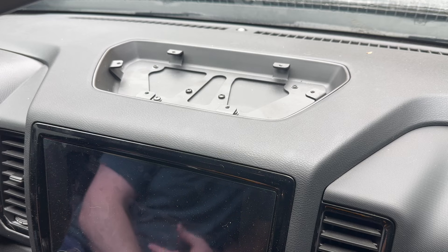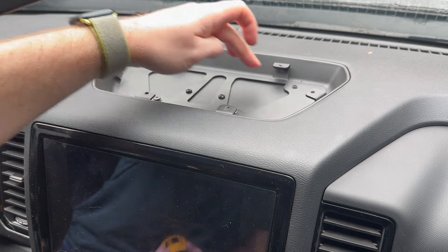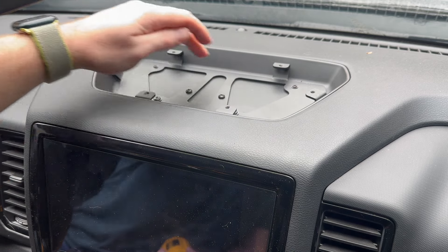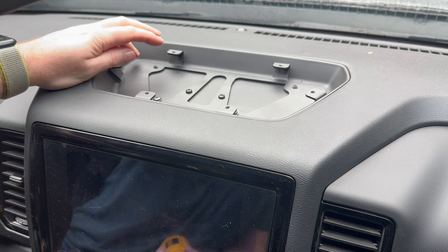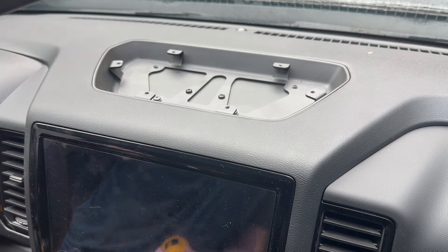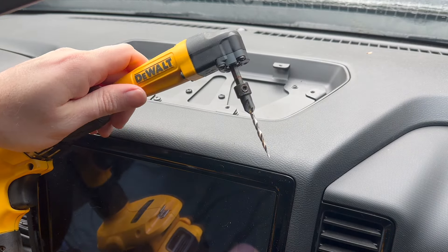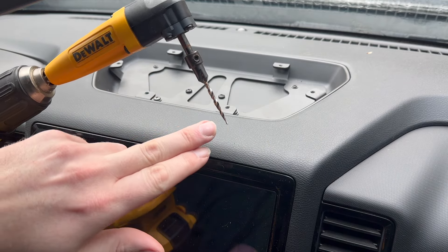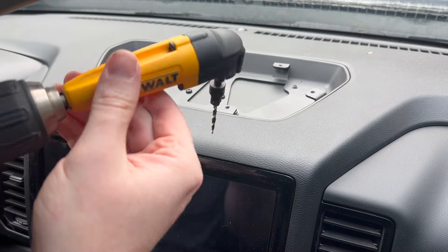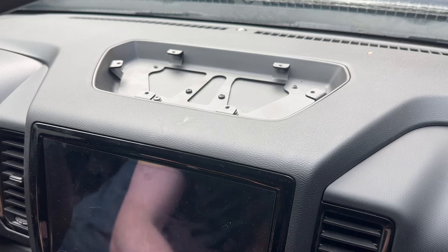I was able to get this mounted in here. These front two screws were not too difficult — those were already drilled out, and these two are actually bolted to the plate from underneath. It's these back two screws that were the toughest, mainly because I can't fit a drill and drill bit in between the windshield and the dash. They supplied two self-tapping screws, but they did not feel self-tapping. I tried as much as I could, put a bunch of weight on the screwdriver, and still could not get those in. So I had to rig up a contraption — I took my drill and attached a right-angle attachment, then found a step drill bit and just barely drilled into the back there to make that hole. So I was able to drill just enough to make that hole for the back plate and get that in.